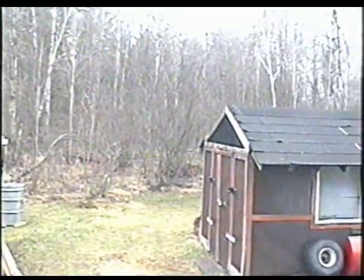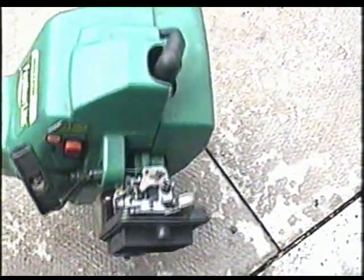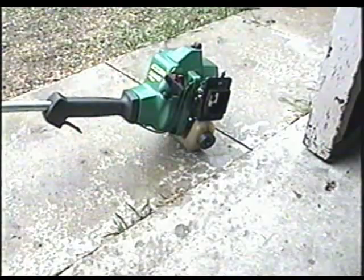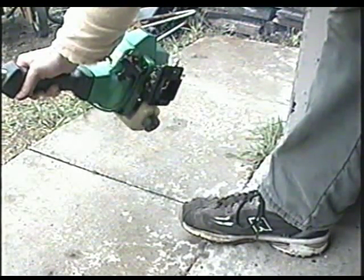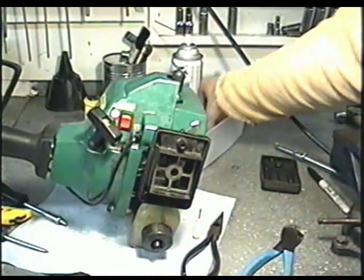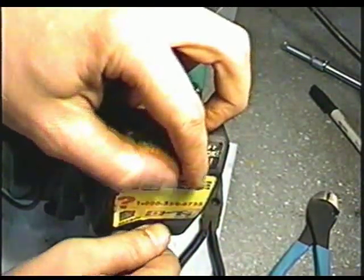It's April 9th and it's snowing and I'm working on a weed eater — kind of crazy. Anyway, it seems to run good now. I'll try it out with another quick start — it should start on the first pull without anything. It's good. I'm going to put back the air filter. This metal grid goes over here inside like that, then the air filter goes in, and this cover goes up like this, and the two Allen screws go on here.